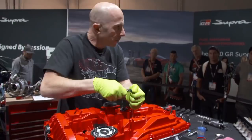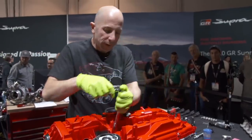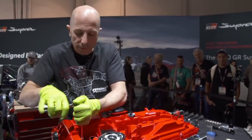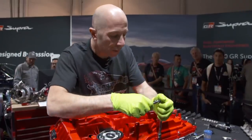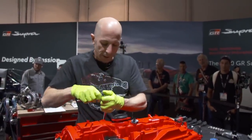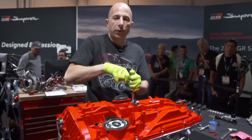How much RPM have you had on the dyno? We've been around 7,000 or so far, and it seemed pretty easy. What'll happen is we're still running the stock camshafts, so that can be a limiter with how much power you can make at higher RPM. But we're also working on some larger camshaft options for this as well.